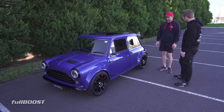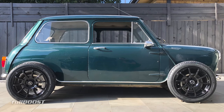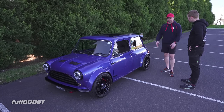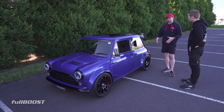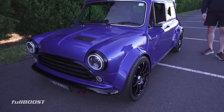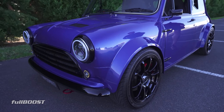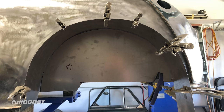The flares were sort of one of the last things I did. I built the car around the wheels because I wanted 15-inch wheels — had to think about the brakes, the drive shafts, et cetera. Big enough brakes to fit. 13-inch wheels is the biggest you'd normally go in a Mini, so I wanted the 15s, but I had to make it look in proportion. The wheel arches are all metal, welded and fabricated to try and look like a current-day car — an inch strip on the outside edge with the correct widths.